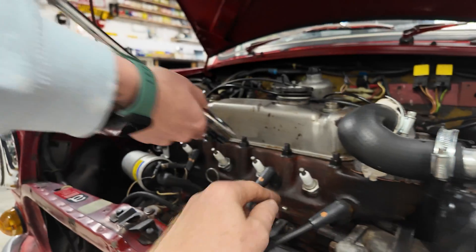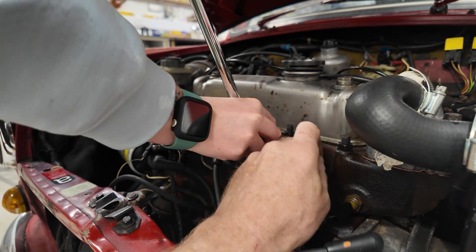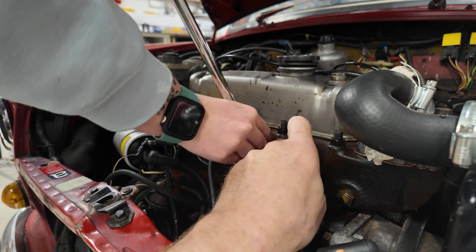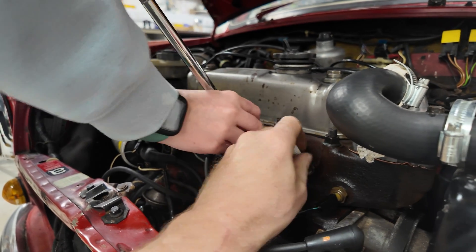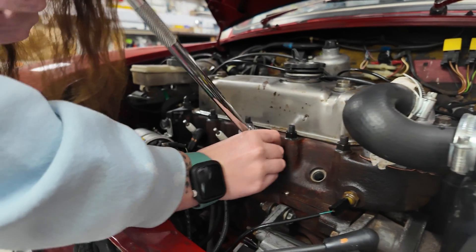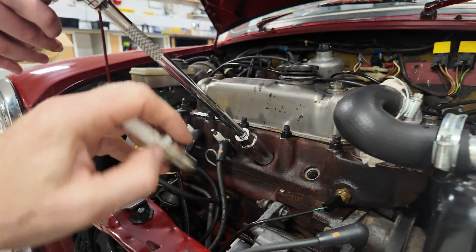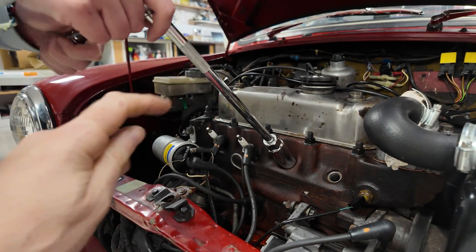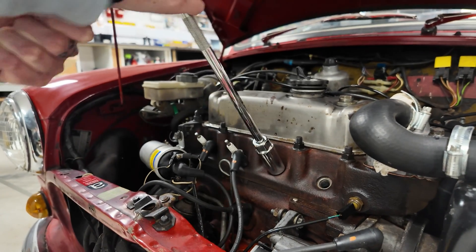While Alicia's working on the next ones - don't snap them. Push it over, there's a rubber bit inside. Don't lean on it too much, just make sure you direct the force into a twist, or you'll snap the spark plug.